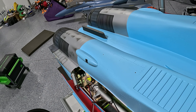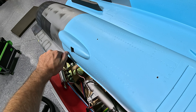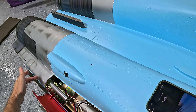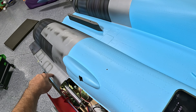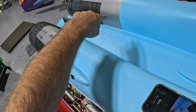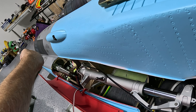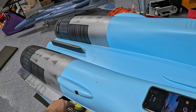I did notice a couple things. It's a good time to tighten up the vertical stabilizer mounts, the rudder mounts, and there's another set in the back I gotta do. I also noticed there's a metal rod — or a bulkhead that runs right here — and there's just a long rectangular piece that this attaches to. It has one screw holding it to that bulkhead. There's a hole over here but there's no bolt in it, and that side's actually loose. You can jar it. So I'm going to drill and screw into that bulkhead from the front side here, and that'll secure both sides. The whole bracket's about to come off the bulkhead.